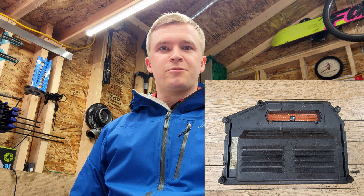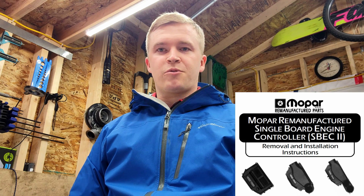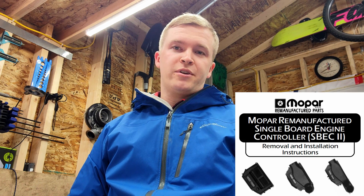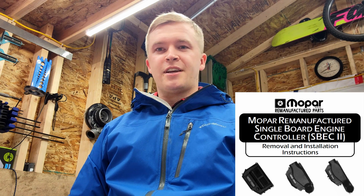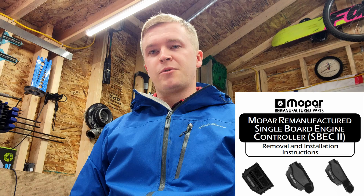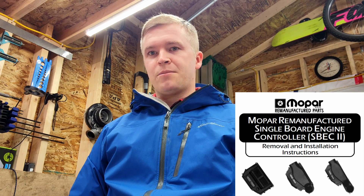You can start the engine with just the starter and the engine will run all by itself. But there are a number of things pre-starting and post-starting the engine that the computer controls, such as charging as well as your grid heaters. When the computer starts to give you problems, they show signs in various places like charging not working or your grid heaters not working properly.